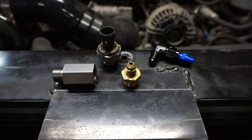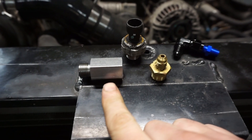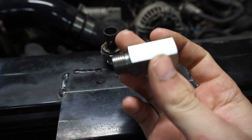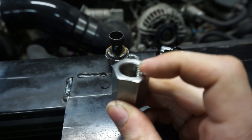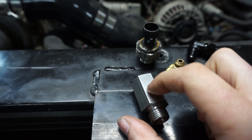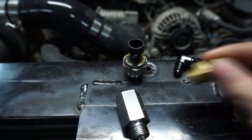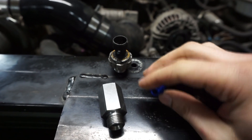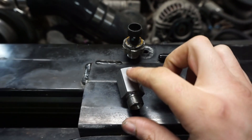The goal for today is to get the oil line finished. I have this fitting — it's an M16 by 1.5 male to M16 1.5 female that I've been talking about in the last couple videos. The sensor goes in the top, and then I'm going to drill a hole and put the 1/8 NPT to 4AN 90-degree fitting on it.